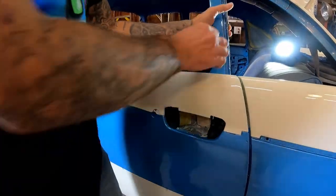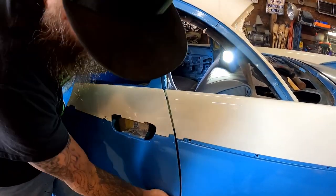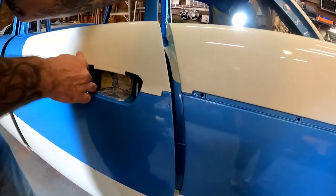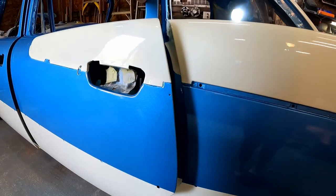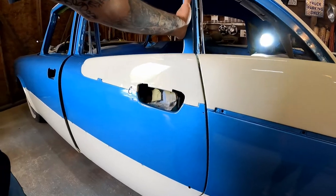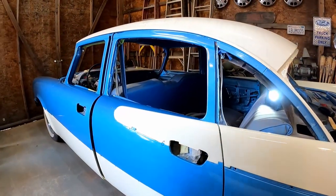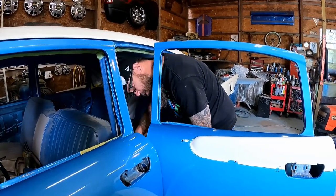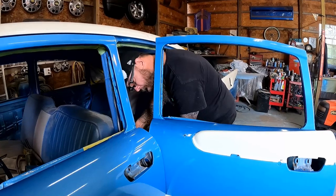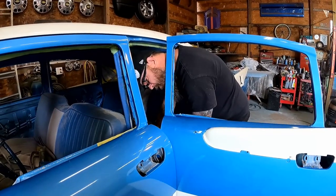I still think — you see the slop? That's what we need for the weather stripping. This actually shuts pretty dang good. I couldn't get it to work with the indoor latch but now it's working. I do still think maybe I could drop it down a little bit, but it feels just like it's supposed to — you get your two clicks, that's what you want, and then a little bit of play for the weather strip. Now that I've got it where I want it I'm just going to snug up all six hinge bolts, top and bottom, and move on to the front door.